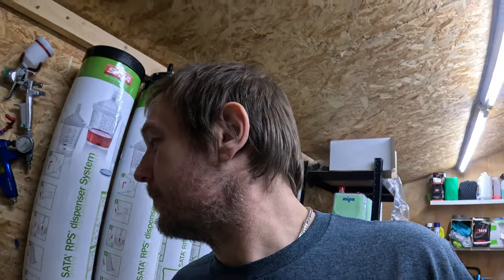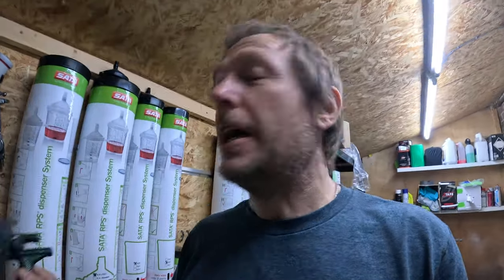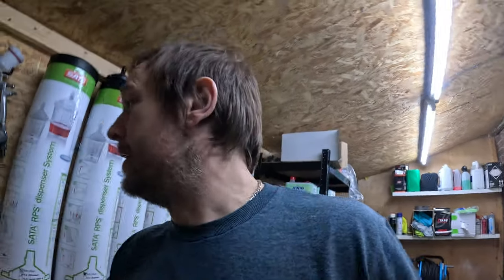The guns I'll be using on this job are the same as on most jobs, but I'll tell you what I'm going to use anyway in case you're new. Base coat will be Satajet X5500 with a 1.2i HVLP, and then clear coat is going to be with my Satajet X5500cc, a 1.3cc RP. The blender coat will go on with the same base coat gun, and clear coat, I'm going to do with CX2 again, so I'm getting some good results with it. I'm pleased with it.